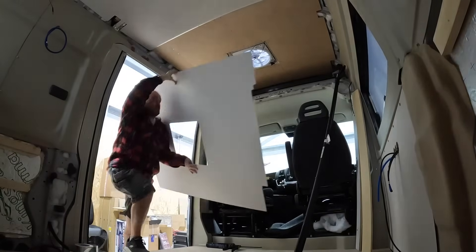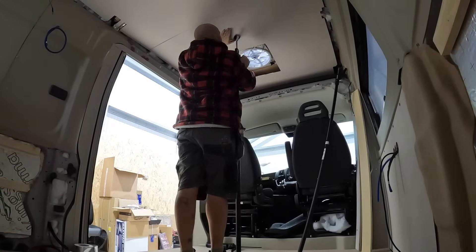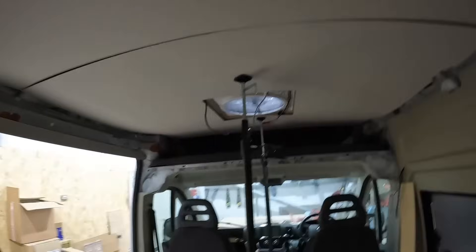Right — the panel's cut. Now time to see if it fits. I've taken quite a few measurements so I'm fairly confident. Let me set it down and have a look. That's not too bad actually — we've got it up nice against the knock-on edge and trim that comes around up there and then this side comes down and around. The only issue — you get this problem in every van — is this dreaded 45-degree angle up on the roof that goes all the way along. I'm thinking I'll do some sort of battens in between all the cross members and try and clad it either in the plastic or probably the ceiling material — I've got more of this and I'll be able to get nicer strips on it.